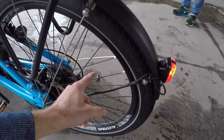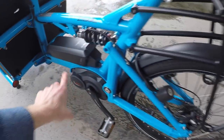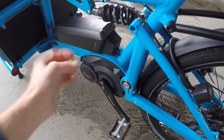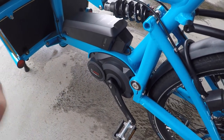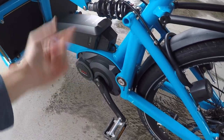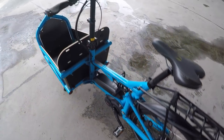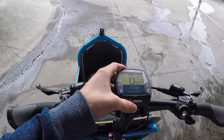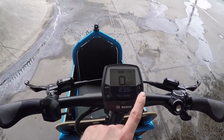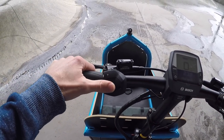And I don't think I said it before, but the motor controller system is measuring real speed, pedal crank rotation, and pedal torque, so how hard you're pushing. And that last one's key, because if you really need to go and you start pushing, the motor responds very quickly. It measures those three signals 1,000 times per second. Pretty cool. Okay, so here we are at the display again. There's that i button on the right, but it's replicated over here on the button pad. Easy to reach.